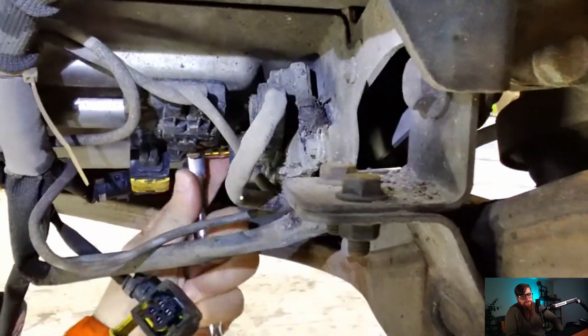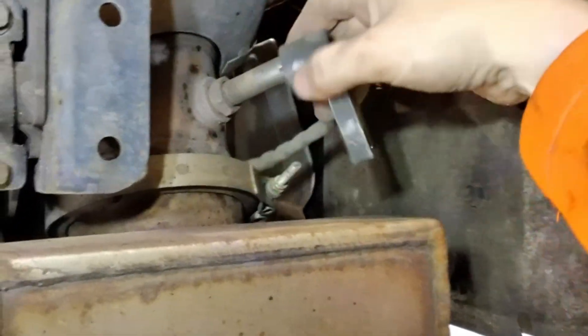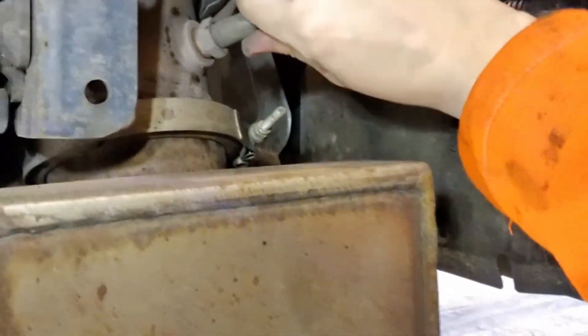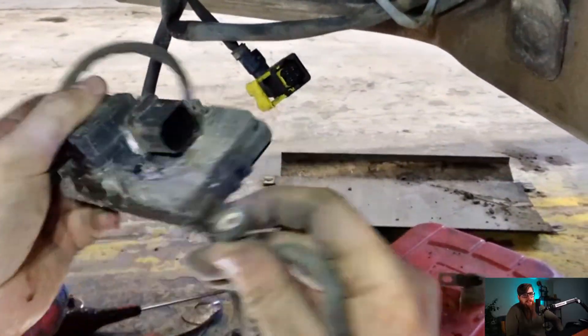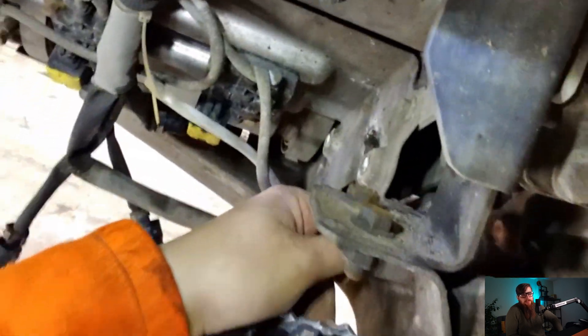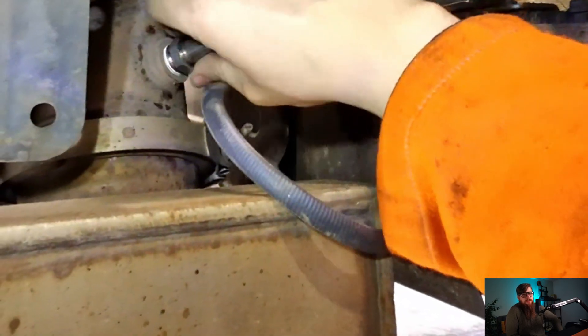With the right size socket, the sensor comes off. As you can see, this NOx sensor has water flowing out the side of the ECU — no wonder the fuse was blowing. It certainly has lasted well compared to the EBS component junk that everyone keeps fitting and bringing here, wondering why the trucks have NOx sensor verification issues.